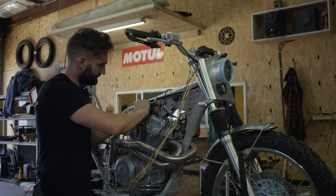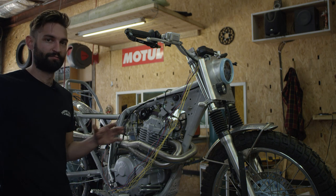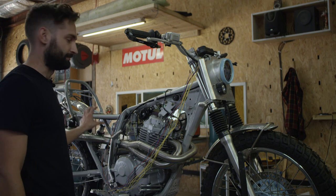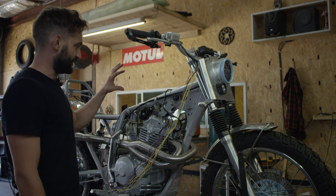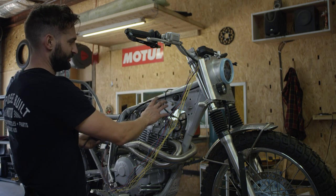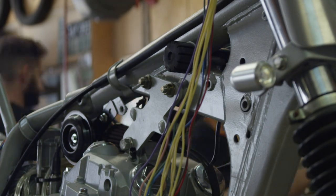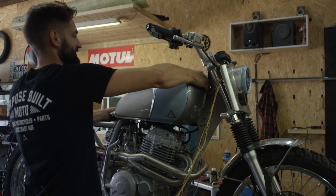The important part before really getting into the wiring is making sure you have provision for everything to be hung on the bike. Being an adventure bike, we're trying to lift all the electronics up — emptied out the hollow where the battery box and airbox used to be. Got your horn and lighting connections up behind the headlight, and your CDI tucked nice and high as well. There's nothing worse than getting three quarters of the way through your wiring and realising you haven't left space for something.